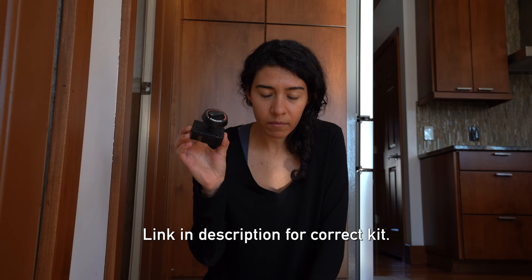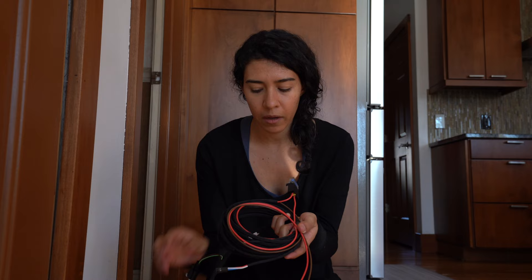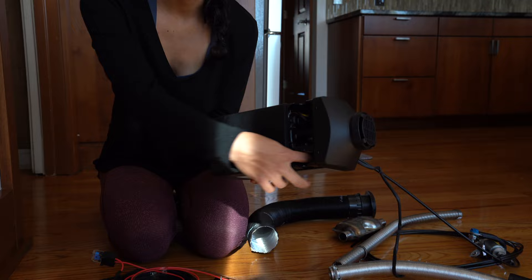Our electrical starts with the control to control the temperature. This older one — from 1995 apparently — was supposed to be the digital version, but our kit didn't come with it, so we ordered it and it's coming. Nevertheless, on the back there's a port to hook up your electrical — it'll go right in there, and you'll see your positive and negative to hook up to your battery source, in our case our 12-volt batteries. There'll be a 15-amp fuse already part of this cable setup, and then this piece goes directly into the Webasto on the very top where you see the words Webasto — it's a lid that pops off, and the connector plugs right in.